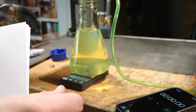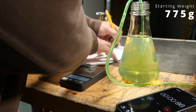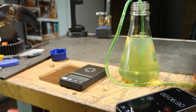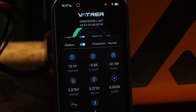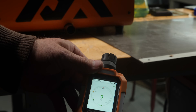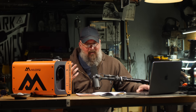I used a gram scale and a 500 milliliter flask — the initial measurement was 775 grams of fuel — and I started the test on high to measure fuel consumption. My clamp meter shows about 4.4 amps on average, while the battery BMS is indicating 3.8–3.9 amps. In an effort to elevate my testing protocols, I also purchased a carbon monoxide detector, and I was baffled — no matter what I did, I could not get it to indicate any carbon monoxide coming off this heater.